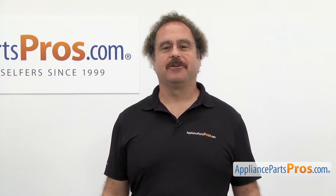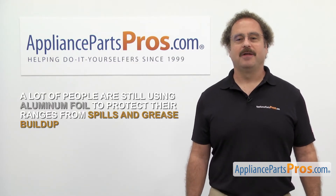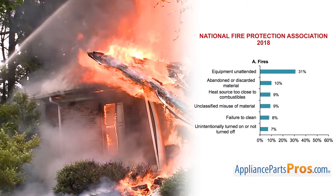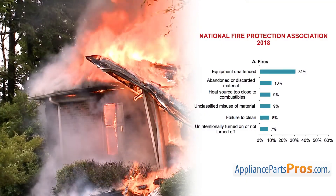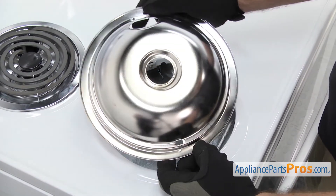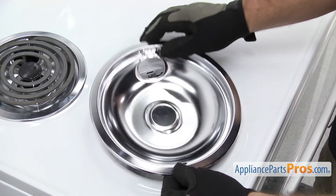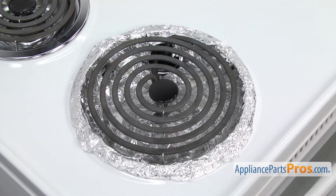Now here are those safety tips we mentioned earlier. A lot of people are still using aluminum foil to protect their ranges from spills and grease buildup. Although it may seem like a good idea, you may not be aware of the dangers it can pose. Firefighters respond to over 170,000 kitchen fires per year, and failing to keep the range clean is linked to more than 13,000 of those. On electric cooktops, many people cover the drip pans with foil so they don't have to clean them. But this can cause moisture retention, making them rust even faster. It can also block airflow, reflect heat back into the elements damaging them, or if the foil touches the element, it could be a shock hazard or start a fire.